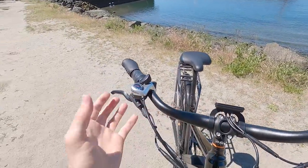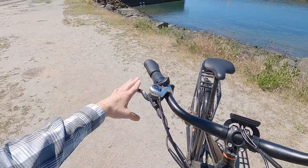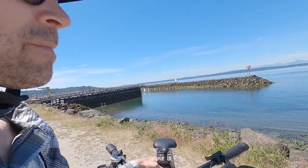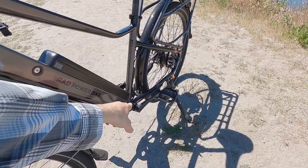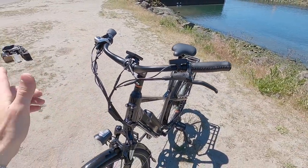And they're not just physical brakes. They also have motor inhibitors built in and brake light activation. So great job with these. A lot of times, some of the mid-drive companies, they'll get hydraulic brakes, but they don't have motor inhibitors because they're like, well, our sensors are pretty good. For a bike like this with a throttle, and it's got that 12-magnet sealed cadence sensor versus a multi-sensor, I feel like this is a great choice. I'm really happy to see that.